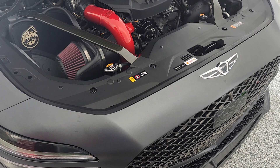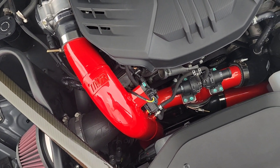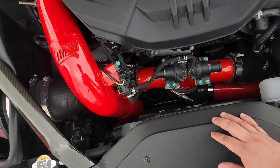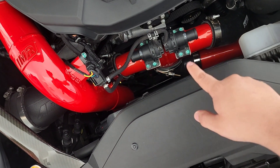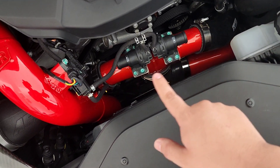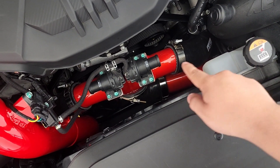Then we'll do a comparison. I want to give you guys different shots and different views. I'll power on the car, give it a few revs. Here are some nice top views of the full system — you can see the pipe coming into the throttle body, all the way down to where the intercooler goes. You have your flange here which holds the blow-off valve, with the upgraded piping going into the turbos, and then the pipe which goes to the intercooler.